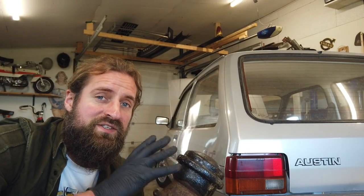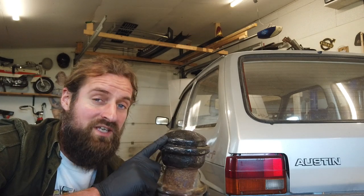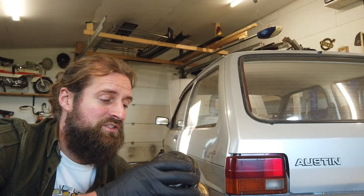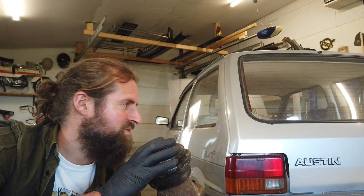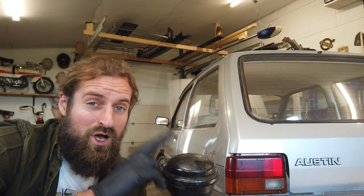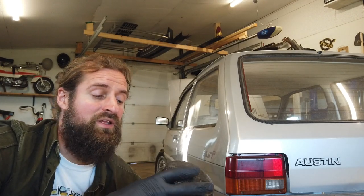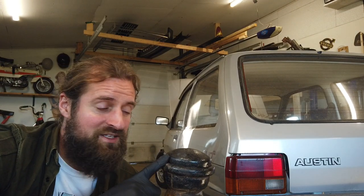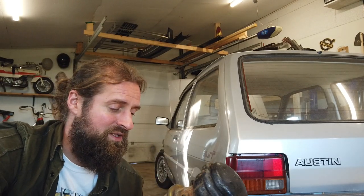Some say that I cannot just pump this system up because doing that it will just be the right height but extremely hard. That is not necessarily the case, but if the nitrogen gas up here escapes then the car will be rock hard even though I pump it up. This is not a very serviceable item — it is meant to just last for the car's life, and as far as I know they are no longer sold, because there's not much left of the British car industry. But there is a company in England that specialises in fitting a valve to these and then pumping them up again, and I'd like to get that done in the future, but not right now — I have to keep the cost down a little bit. So I'm just going to hope that the gas is all right in these. Maybe it won't be as comfy as from factory, but as long as it's not rock hard I will be happy about it.